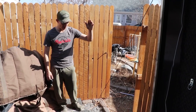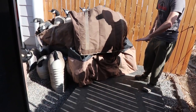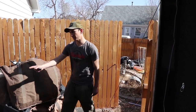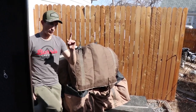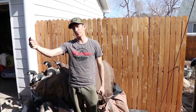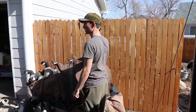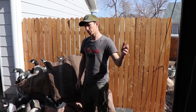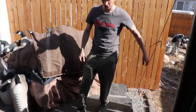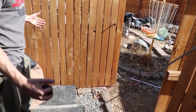One more thing — you'll see I only have a wire on one side. The reason we did that is it's just easier to get in and out. That's one of the disadvantages of the fold-down door system versus barn door style trailers. Having this cable on one side lets you easily skip this corner and come out this way. Pro tip: make sure you leave the open side the same side as your door. The action side of your trailer is always going to be the side with the side door. The rhino-lined gate is ultimately what you're going to slip on if it's just solid wood — so this thing is grippy as can be.